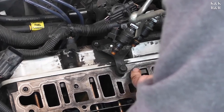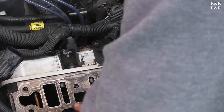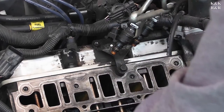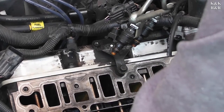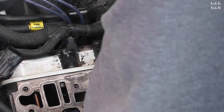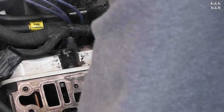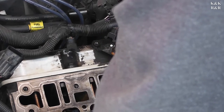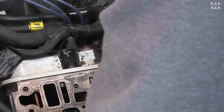The key thing you're looking for is smoothness. Make sure you don't feel any speed bumps — like we got a little bit here at this cooling port. You want to do the same on the front bank. After you're done, you want to spend a great deal of time with your shop vac cleaning all the small residue up.